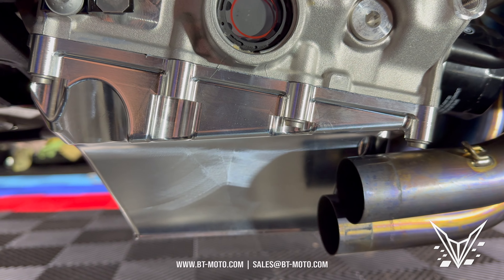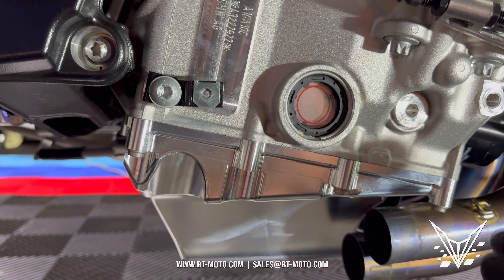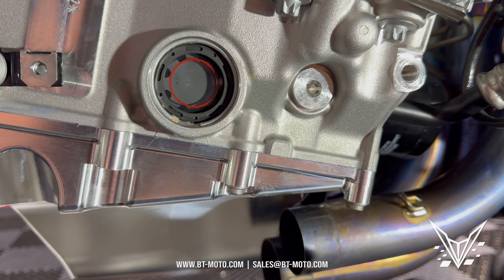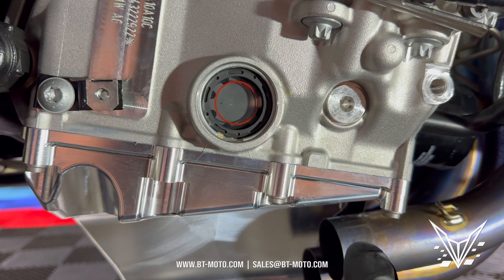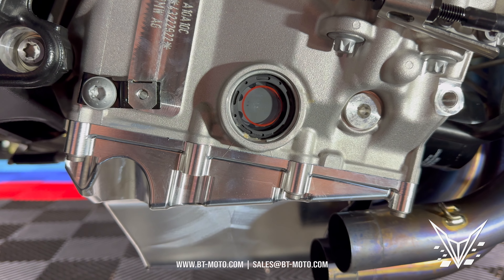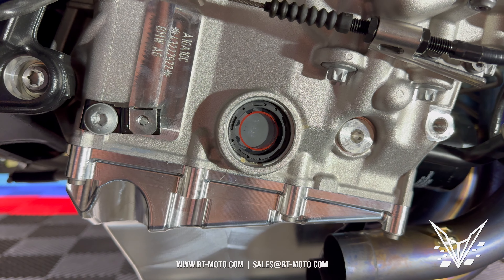The pan is set — look at that beauty. It was really easy to slide in there. I verified with a video scope that the pickup was in the right spot — easy, no difficulty whatsoever. Now we've got to secure all of these bolts, which are torqued to three newton meters and then an additional 90 degrees beyond that. So get to three newton meters, then twist an additional 90 degrees, and those bolts are set. Again, these are torque-to-yield — do not use the stock ones again. I'll place a bolt here and a diagonal on the other side, tighten this one then that one, then work in an X formation until all bolts are in, then do an additional pass to make sure they're 100%.